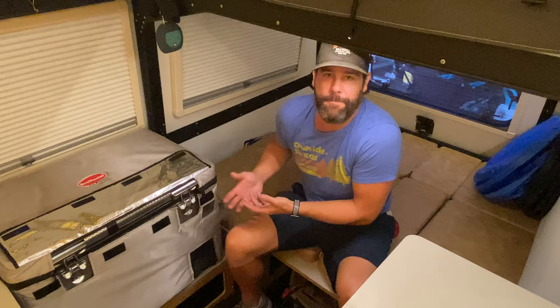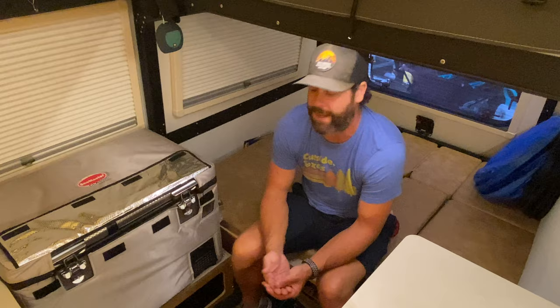Lastly, a couple of comments anticipating some questions. What kind of draw does it have on power? I really don't have a baseline reference — I don't know if it's more efficient than another model. Ryan and Libby from CB Adventure Supply use it in one of their trailers and love it; they say it's pretty efficient from a power perspective, so I trust them on that. One nice feature is that you can control when this will cut off based on the voltage of your batteries. You can set it to, say, 11.8 volts, and when it detects that level the unit will actually turn itself off to help you save power.